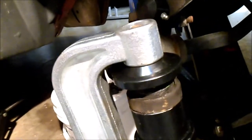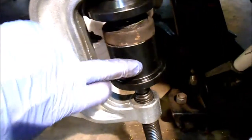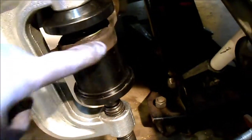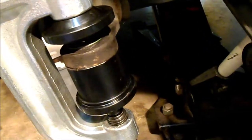Here's what the clamp looks like. There's an adapter with a larger hole that goes on top — the nut from the ball joint is going to come through the top and push down on it. On the bottom you have this tube that pushes down on it, and it's going to push the ball joint out through the lower control arm and come out into this tube.